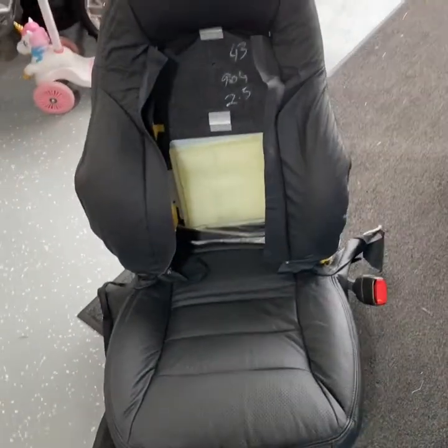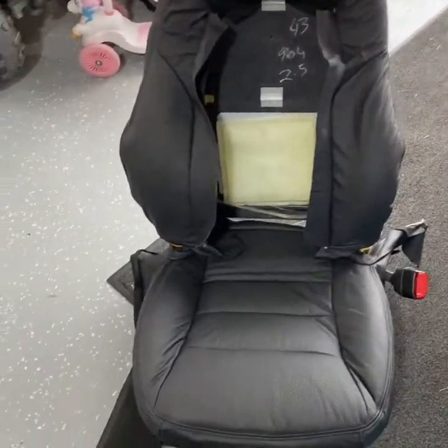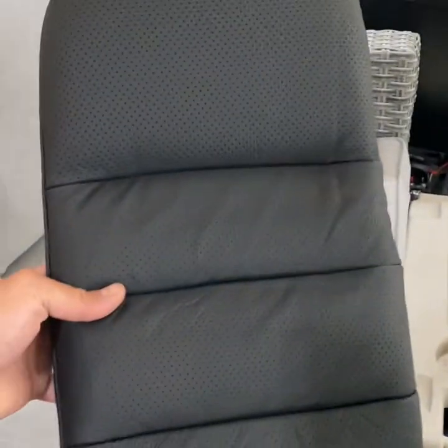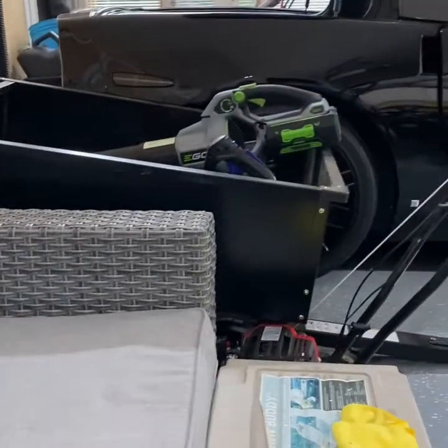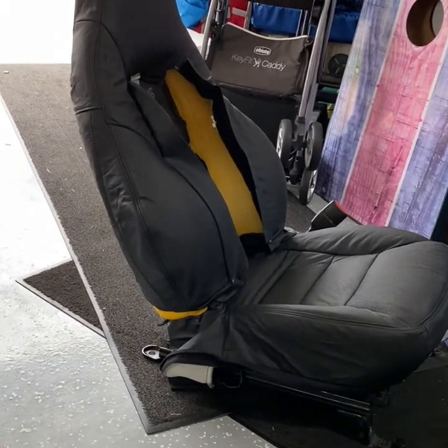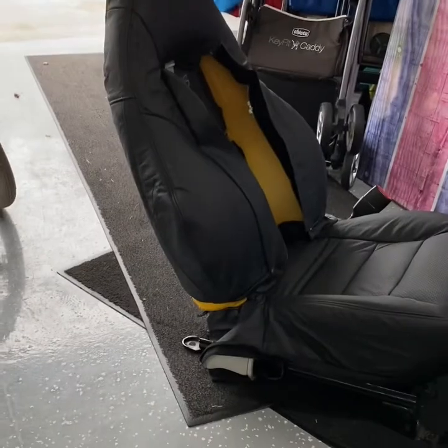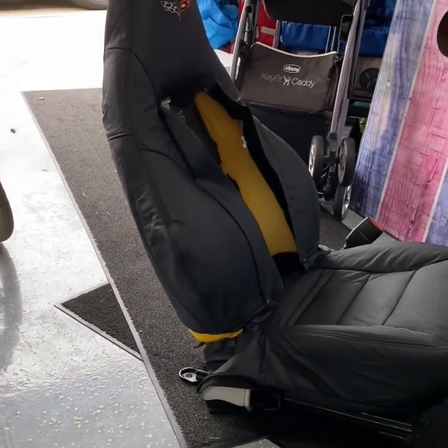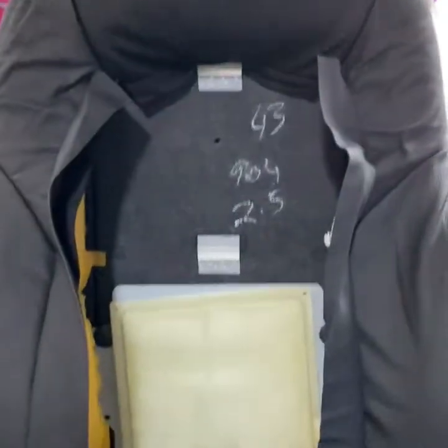What is going on everybody - this is Mike from The Last Corvette. So it's been about a week since I did anything to the seat. I went through and took the old skins apart. Here is the new reupholstered center cushion - started to take all the new hardware out of the trunk to finally reassemble the seat. It really does help to overlay the new skins over the seat and just let it sit there and acclimate. You're not going to get all the wrinkles out right away - that will be the finishing step when I take a steamer to tighten everything up.